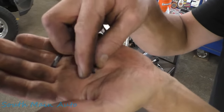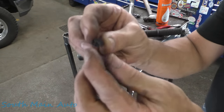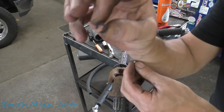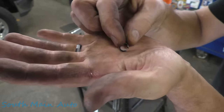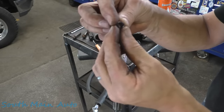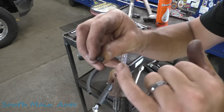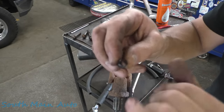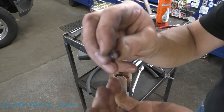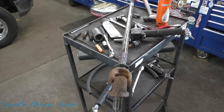So that's what that looks like. I don't know if any of it matters to you, but that's the piece that was on the inside. I had some slag on it. That's basically the bolt that we drilled out, and it's the little bit that's left in there. If you just drill it paper thin, oftentimes you just take the chisel and give it a little tippy tap. But sometimes you just reach in with a torch and get the one side. You can see I got this side here, but it just more or less melted it together. But anyhow, that's that. Keep on keeping on.